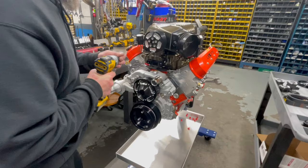So there it is. Gandrud Chevrolet LSX376 B15. 15 pounds of boost. We got the Whipple supercharger on top. The Wegner front accessory drive in front to spin everything. 10 rib belt and then a 6 rib. 10 and a 6. Alternator, power steering, ATI super dampener, other tensioner, water pump under there, AC. So I'll have cold AC with a big old nasty Whipple blower. So that's assembled right now, and I think tomorrow we're going to dyno it.